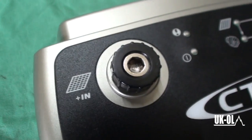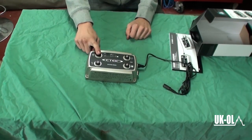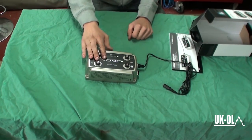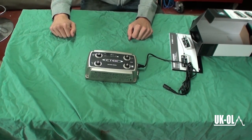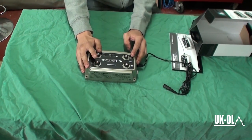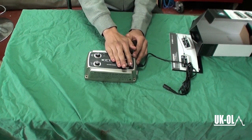What's really neat about this unit is it's also an MPPT solar regulator. So if you have a solar panel installed, all you have to do is plug it directly into this device, and it will regulate the power coming from your solar panel and use it to charge your batteries when your starter battery is unable to charge. The unit detects that your starter battery is being charged and will only charge the leisure battery once the starter battery is fully charged, diverting a maximum of 20 amps.